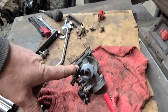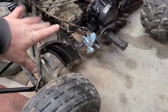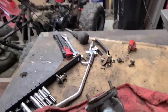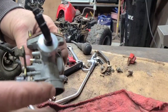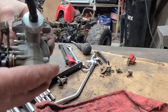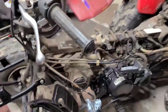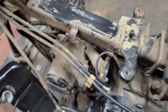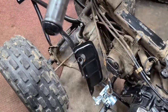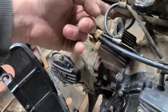Alright, I tried their slide on my carburetor and it fit, and mine is on their carburetor, so hopefully we're okay there. The other thing that is different on this one, mine has studs here. That one takes bolts. I'm not sure how you can get the bolt in from the backside of the intake because, I'll show you. One hole right here on the turn. How would you get a bolt in there? So, yeah, this one's got nuts on this side, so you put the bolt in from this side, which is a lot easier on this one. But not so easy on that one.